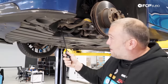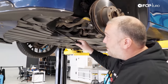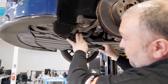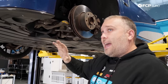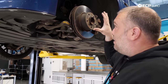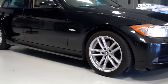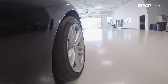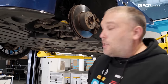If it was really bad, you can come in here with a pry bar and see how much side-to-side movement you can get. If you came in from behind with a pry bar on a worn bushing, you'd actually get this forward-and-rearward motion. If this bushing was extremely worn out, there'd be a lot of play around this point. This control arm keeps the entire front wheel located in the wheel well, resisting all rearward forces as you travel straight. Any play in this bushing is going to be extremely notable — you could get shimmying around 50 to 60 miles an hour or nasty vibration under braking.